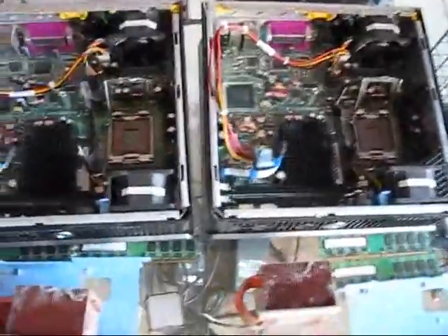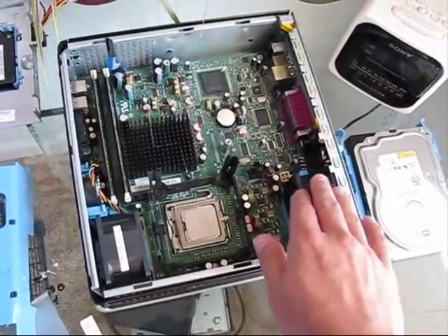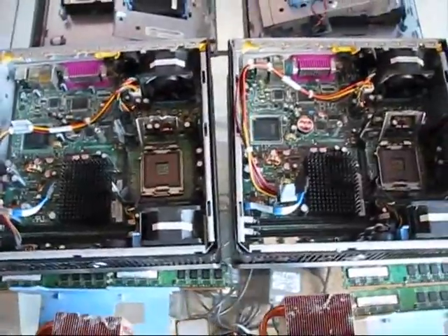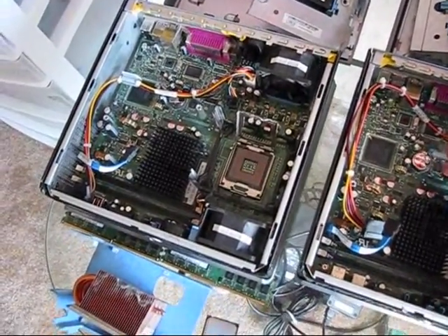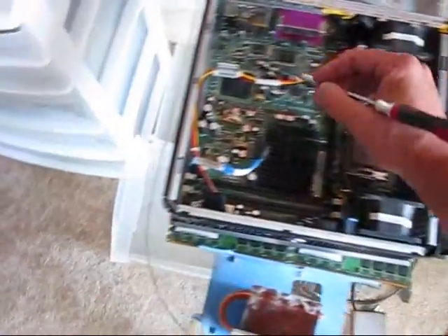It's ready for the deep cleaning. With some more experience, it's not very easy removing all those fans — it takes some additional time. This is why it's better just to keep them inside the system. The new thermal compound will be applied after those two CPUs are cleaned as well. Make sure that you remove the BIOS batteries on both systems, because we don't want to accidentally short something.